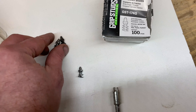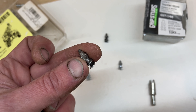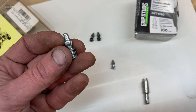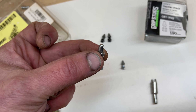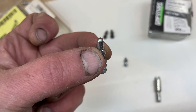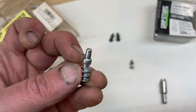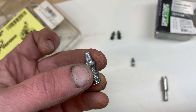These are some off-brands I've tried. This is a Rooster, which is an off-brand - again, did not hold up well in the rear but actually worked pretty decent in the front. I still have some on my son's bike. This is the type of stud you'd typically put in your rear tire - you're looking for a long projection and a carbide tip. This is a knockoff from Alibaba that looks identical to Grip Studs. I tested a genuine Grip Stud against this with a grinder and they both seemed to hold up the same, but where they differ is once you get out on the trail - the carbides come off, the studs bend over, they're just not worth your time.